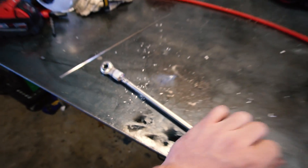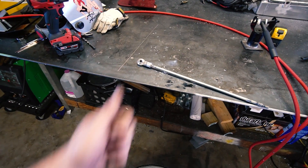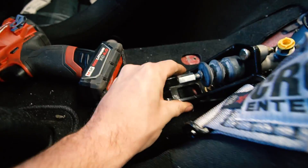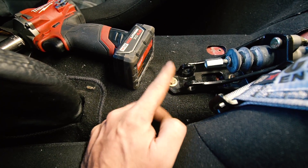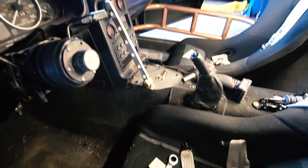Ta-da! We're just letting this cool down, then we can throw it in and make sure everything works together properly. I was going to through-bolt the master cylinder bracket, but since it backs up to the shelf here, I don't think it's going to be a problem, so I riv-nutted it. Again, if this is a problem we'll just pull the riv-nuts out and bolt a plate on the bottom — no big deal. I think it'll be good though because it's solid. So hooray, almost done!